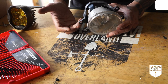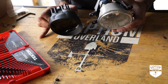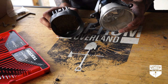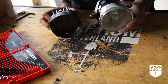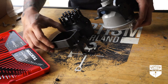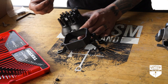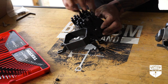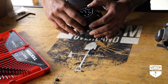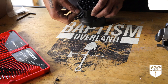Here's the OEM fog light that came out of the 4Runner. The Diode Dynamics fog light was created specifically for the 5th Gen 4Runner, so when you go to install it, just make sure that they're oriented the same way — one side is longer than the other, so it has to go in the exact same way as the OEM one did, otherwise they're not going to fit. To add the bracket — this is the bracket that comes with your Diode Dynamics kit — it's basically an exact match to the 4Runner one where one side is longer than the other as well. To put this bracket on is really quite easy: there are two slots where you're going to drop in the nuts, then put the bracket on, put in the bolt with the washer, and those slots hold the nuts in place so you can screw it in a lot easier.